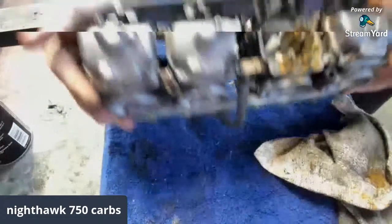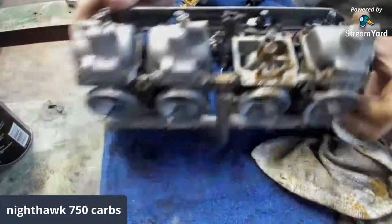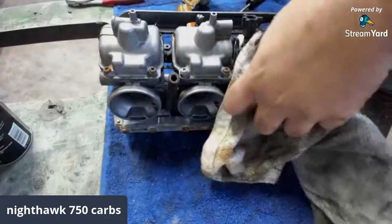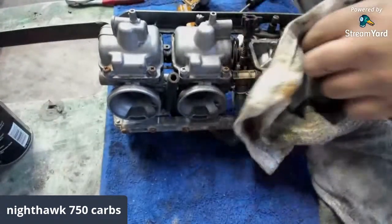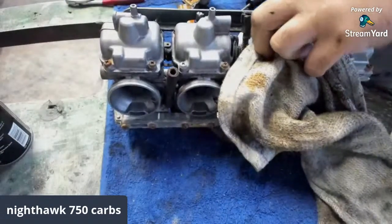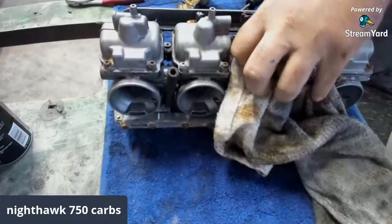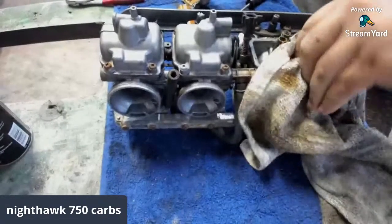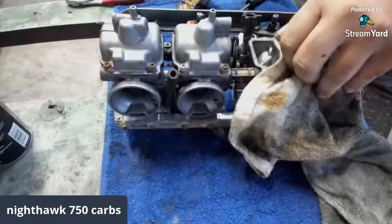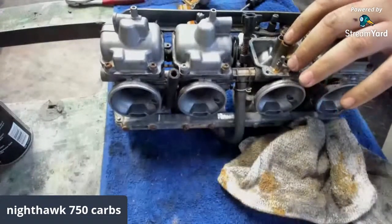Propane torch. For what? You need a propane torch for? I don't have one. Oh, clean the jet out? Shoot. How I usually do them, you can just boil them. If you can't get the stuff out, I can usually get them blown out with compressed air. Soak them and then blow them out with compressed air. Know what I mean?